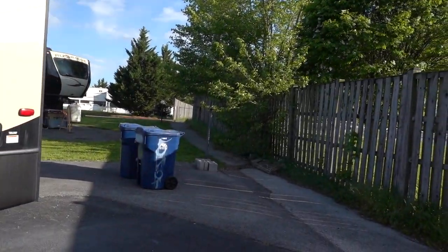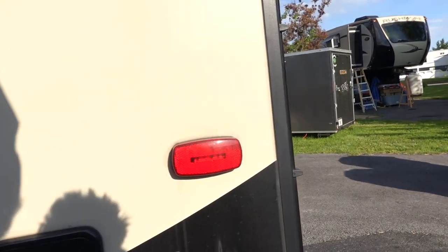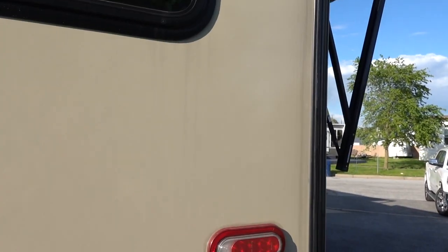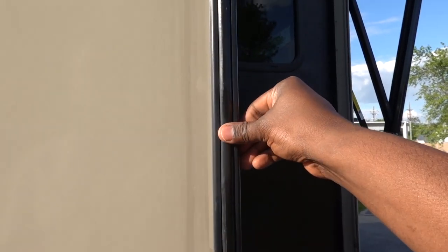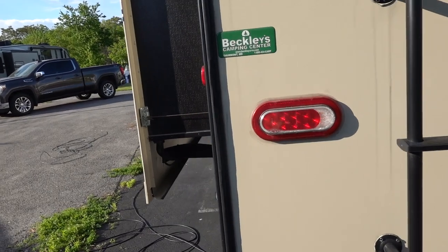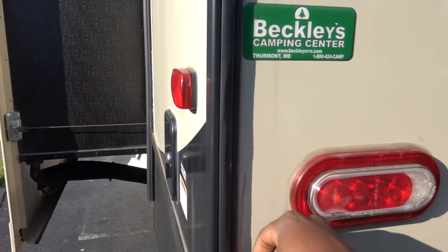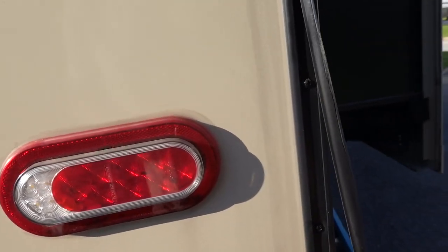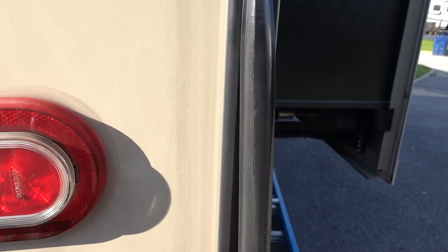You've got to make sure you use your RV and do your maintenance. Something I have to do this year — and I'll probably do a video on it — is replace these trim pieces back here. My RV is from 2018, it's a 2019 model, and these basically lasted two and a half years before needing replacement. Figure two years these things last. You want to make sure you replace them because water sits up on those screws and will find its way inside the RV.